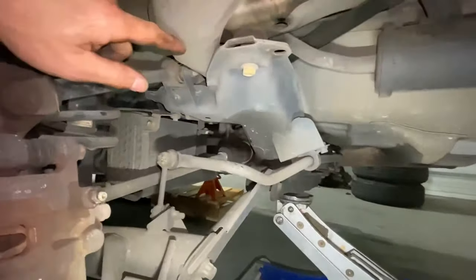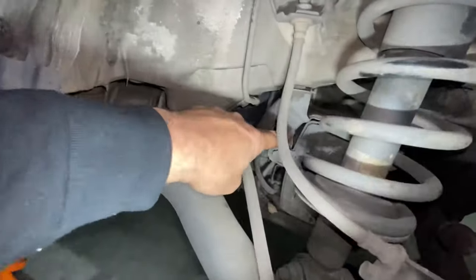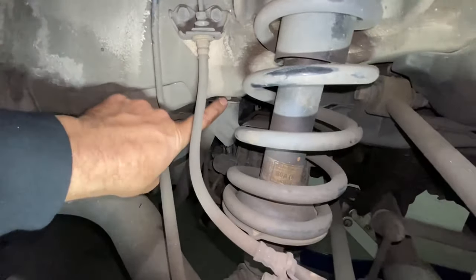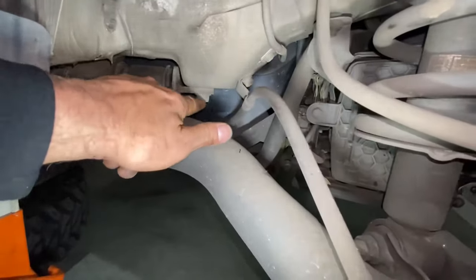For the back it's about the same as the front. You've got four main bolts to hold the subframe to the body: one here and then one right there. There's a charcoal canister you will lower down with that one bolt — there's a spacer that goes in here. And then these two bolts here for the rear trailing arm: those come out and there's a spacer that goes in between those.